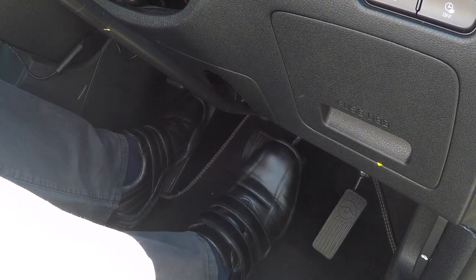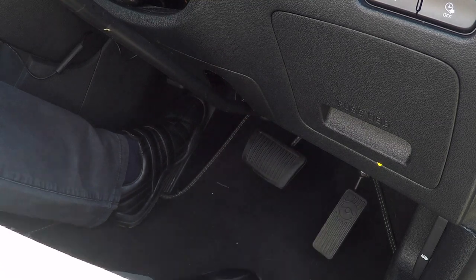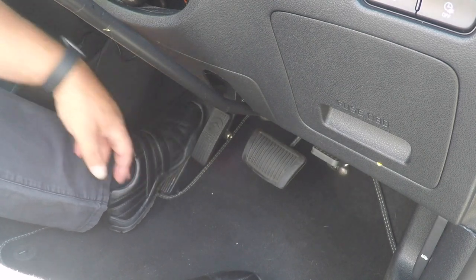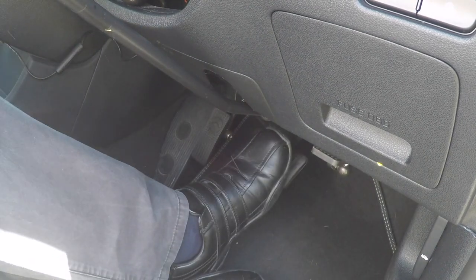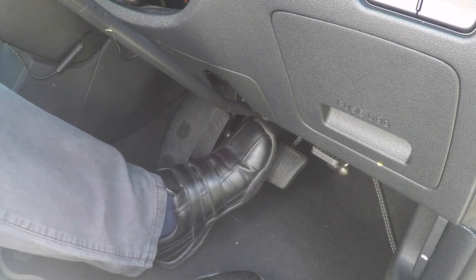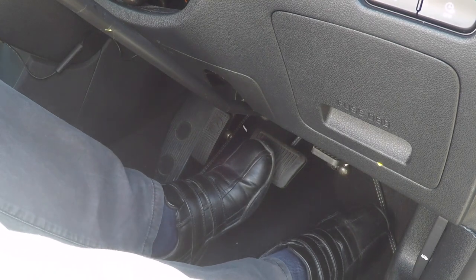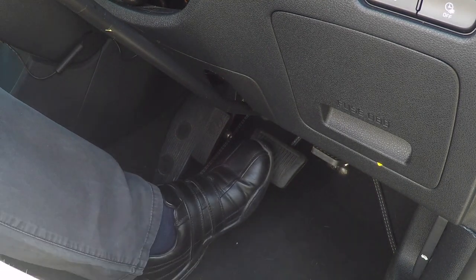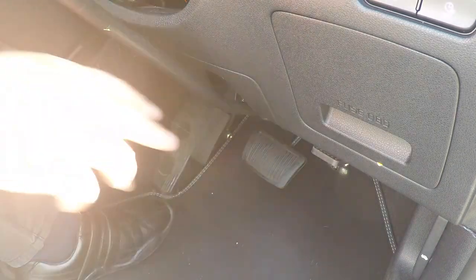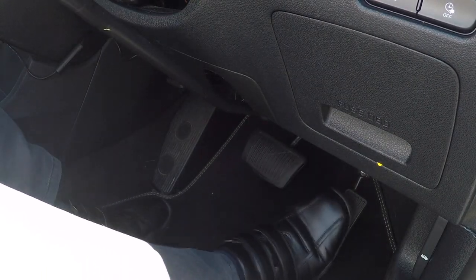The most common design of left foot accelerator is the twin flip accelerator. In its standard configuration the accelerator is on the right of the brake. Pull the left pedal down and the right one flips out of the way, allowing you to operate the accelerator and brake comfortably with your left foot. The flipped-away right pedal also gives more space to extend your right foot into the footwell without interfering with the pedal. When somebody else wants to drive conventionally, they simply pull down the right pedal and the left one flips up — so there's only ever one pedal down at any one time.